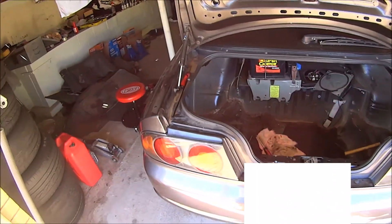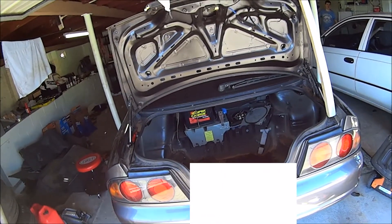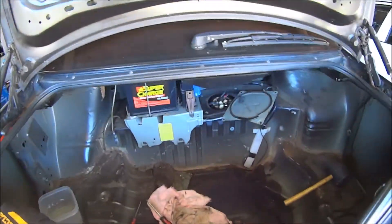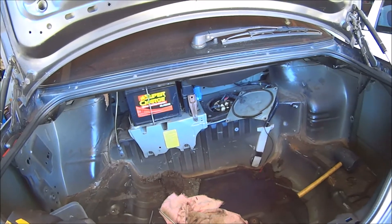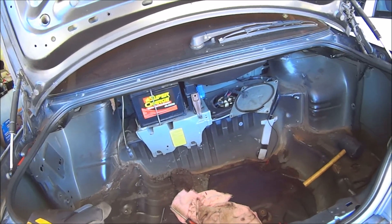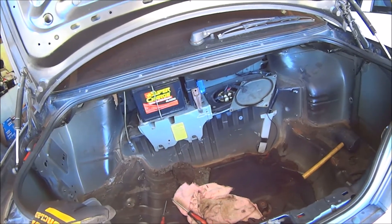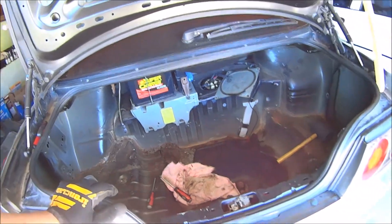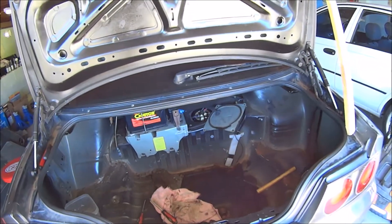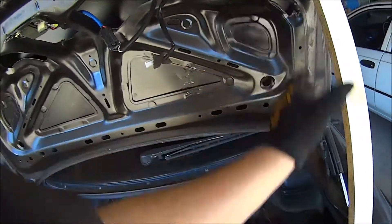I didn't film any of the actual putting it back in. None of it was in there properly, which is why it came out as a bit of a clusterfuck. There are two plugs on the underside of that cap you should undo to help with leaving the fuel level sender behind, but it had fallen off and so the fuel pump wasn't mounted correctly — it was just floating around in there. Good job I pulled it all out; it's all now mounted correctly.